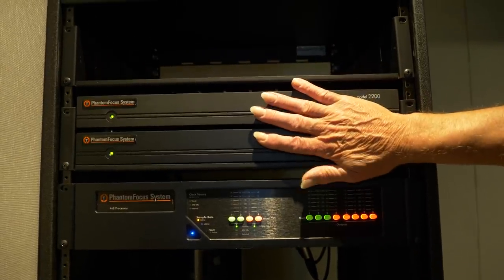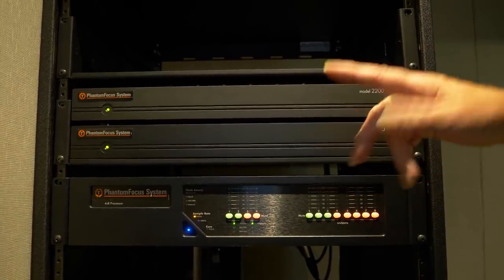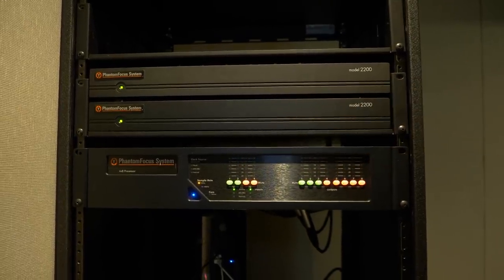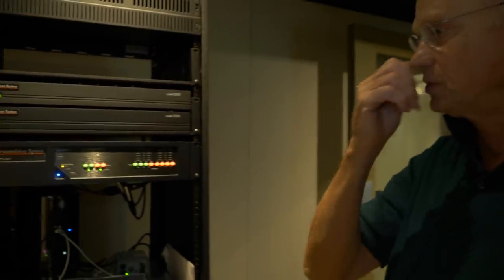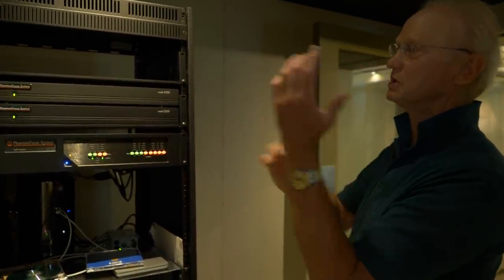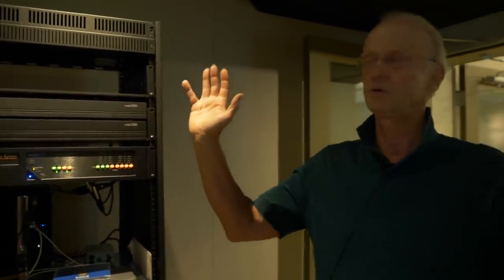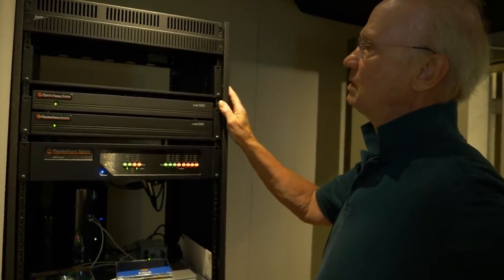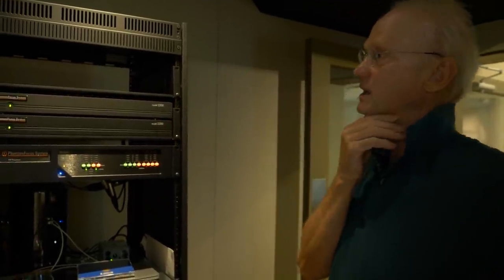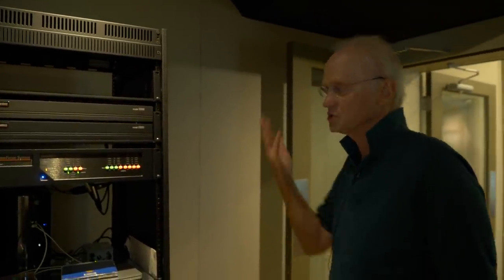These are the amps that are built by ATI. So there's just two channels here. In this case, they're 4-ohm speakers, so you're running 300 watts a speaker. For the bi-amp, there's four of these, or with the new ATIs I'm using, there's two. There's a D-class, and then there's also the Morris Kessler Signature. They both come in racks with modules, so you can go up to seven channels for 5.1 or whatever you want. In the bi-amp, it's 500 watts, so you get two for the woofers and one channel for each tweeter.